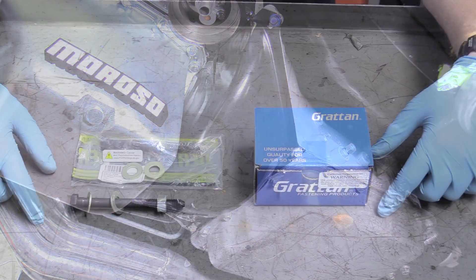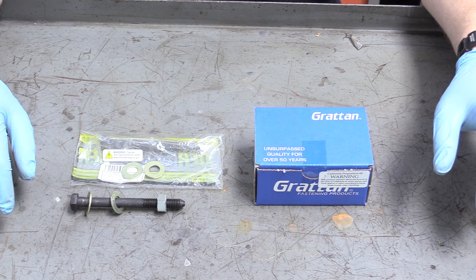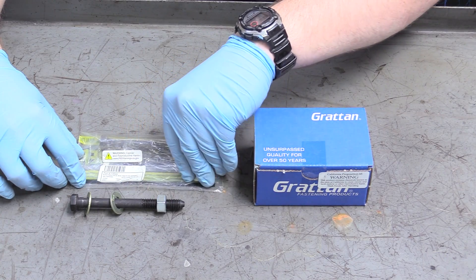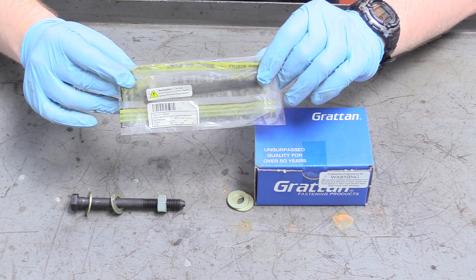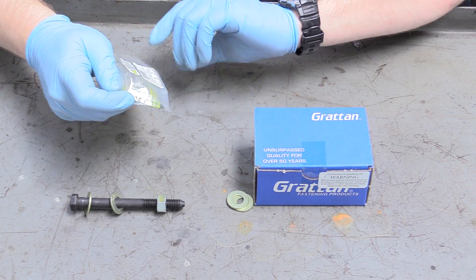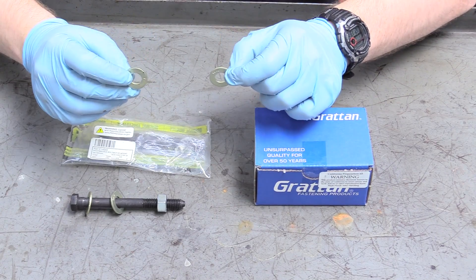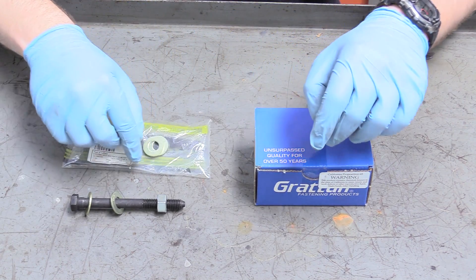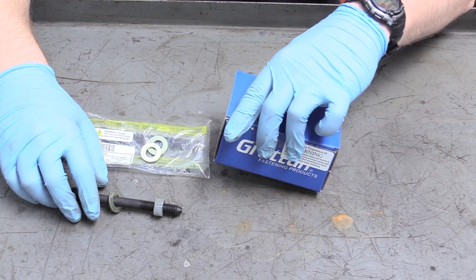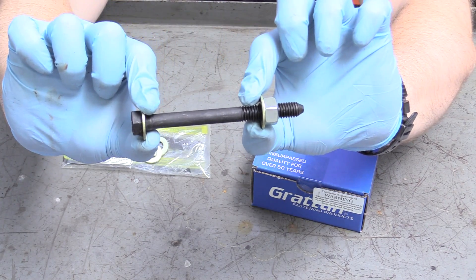Transmission shield installed. The next thing we're going to work on is putting the motor mount bolts in. This is a little interesting because I couldn't really find exactly what nuts and bolts to use here, but online I found this — it's made by OER, link down below in the description. It is part number 14344, steering box slash motor mount bolt. You're going to need two of these. I like using washers — I've got these 7/16 washers and I'm going to put those on both sides. The nut is a 7/16 by 14. You're basically going to build it just like this with the motor mount in the middle.